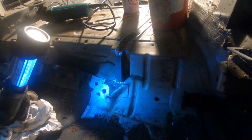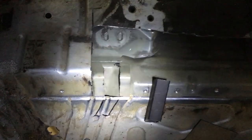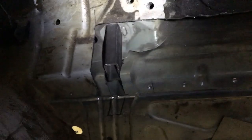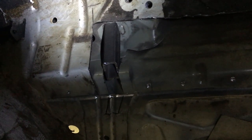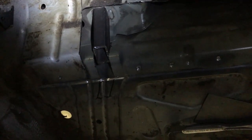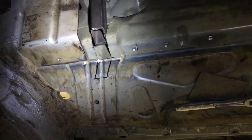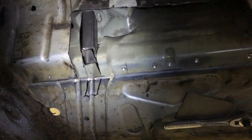Welded all the way through right on top. This is the front driver side — you can see there's a notch cut in that panel. Here's a concept of what it's going to look like: we're going to come right off the top of that subframe mount, directly welded to it, then integrate it back into that corner and tuck it underneath the flap. Where that marker is, that's where the bolt goes — all triangulated. There's a gully there so we'll get a triangle in and it'll be super strong, all tacked together as one monocoque unit.